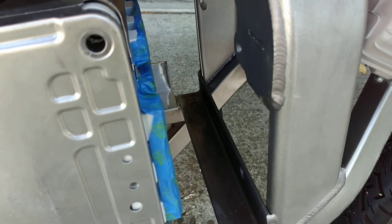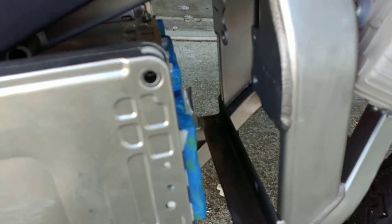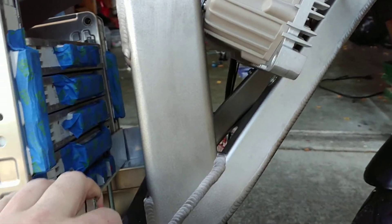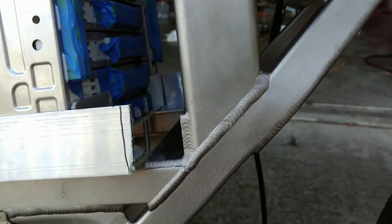In this general area here, I plan on putting the contactor — which is a 400 amp contactor — as well as a couple of the high voltage components like the shunt and shunt monitoring system. Then directly underneath the controller, in that tiny area, I'm going to have my 12 volt converter box. That 12 volt box is going to handle lighting components, the horn, and the ancillaries — like the dash, which needs a 12 volt output.